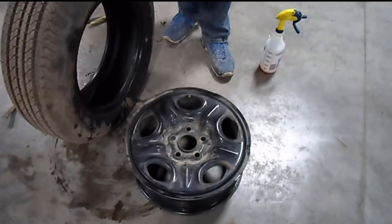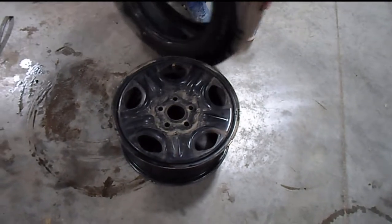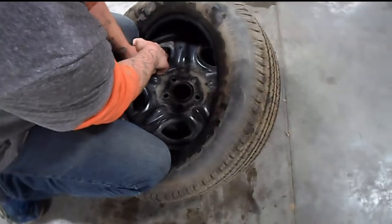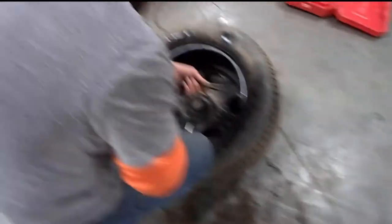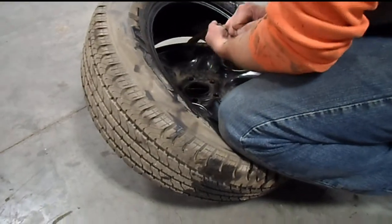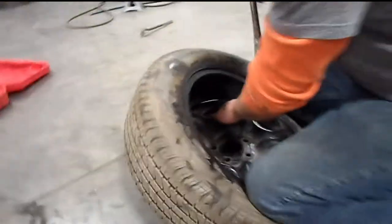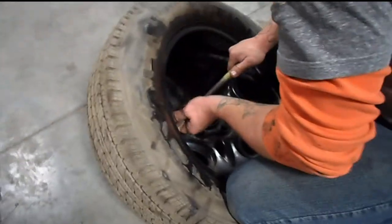When I put a tire back on the rim, the valve stem towards me, and we ain't jeopardizing hurting it. All you want to do is get her set in there best you can. Use these crowbars again, and slide her back on. Again, you want to reach in and hit the lip. Drive it around. So he's just working the first lip onto the rim.